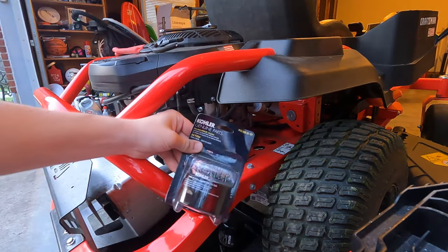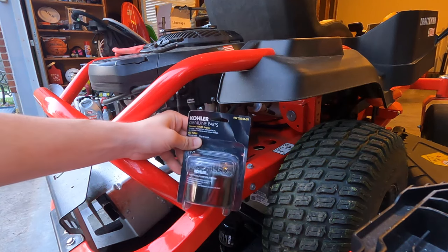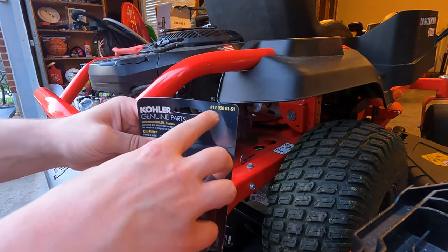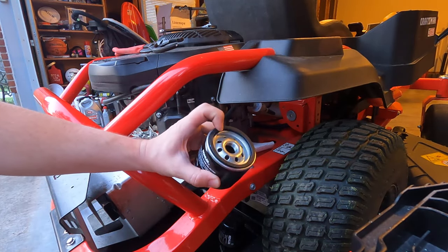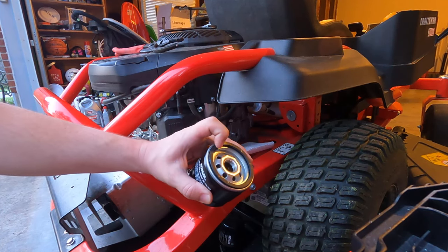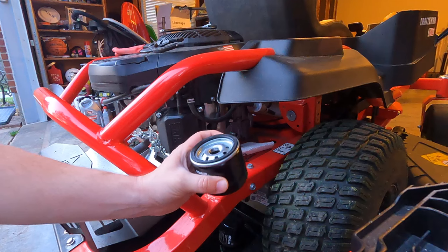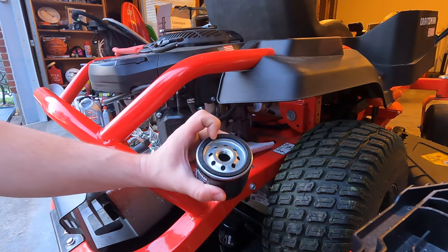You can get these from any Lowe's, Home Depot, Tractor Supply, even Kohler if you really want to. Once again, in the description below. I think everyone should know this, but I'm saying it anyway. Make sure you get some brand new clean oil and oil up this rubber gasket right here, so it makes a good seal against the machine surface of the engine. Once again, virgin oil right here on that gasket.